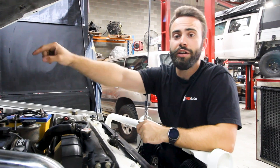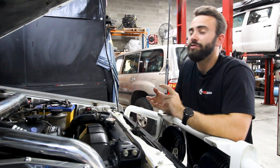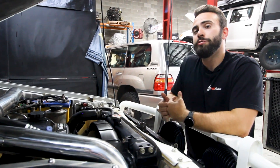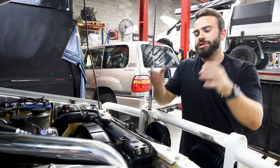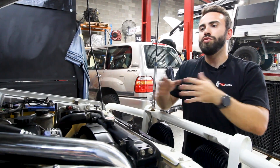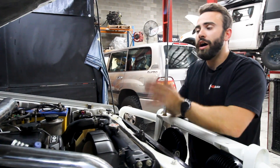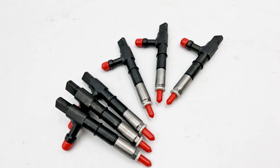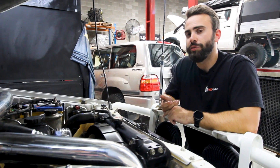The next thing you're going to need is a set of high-flow injectors. The stock injectors are only capable of about 255–260 horsepower on a fresh set with a good pump on a good day. I don't like pushing an injector that hard though, because the injector's physical size is only so big, and working it too hard for too long is where you get engine issues from. So the second you want more than 230 horsepower, I highly recommend going to a higher-flowing set of injectors. In this case we've gone for a 300–330 horsepower injector for this UFI 18G turbo — it's a phenomenal combination, a very clean injector, so you'll have no soot as well as a ton of power available.